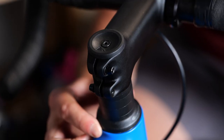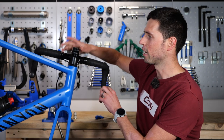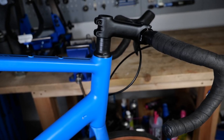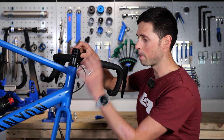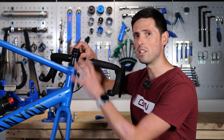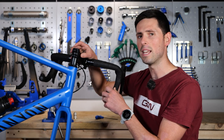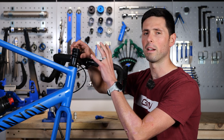If you're having trouble with your headset and struggling to remove any excess play, there are a number of different reasons that you might be having that problem. It could be that you're trying to adjust the preload using the top cap and bolt whilst the stem bolts are already done up tight — that means that preload isn't going to work its way all the way down to the bearings, so it's going to have the play in. It could be that the bearings are just worn out and have play within the units themselves, or it could be that you've recently just taken everything apart and haven't quite put it back together correctly or you haven't got one of the parts the correct way around. In that instance, I'd say take everything apart, clean it up, and check that you've fitted everything in the correct order.